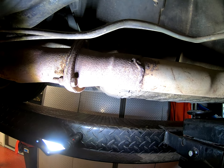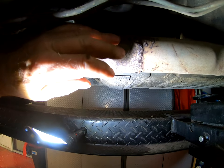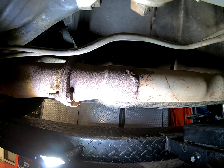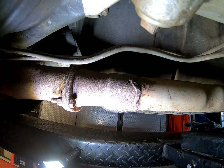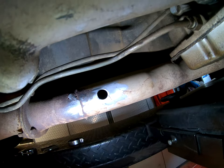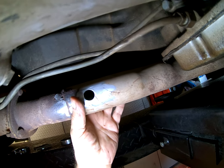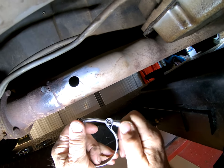So that's the plan — let's mark this up. I've got to make sure I've got room for the clamps, so I may actually have to do a bit of grinding here so I can get the clamp on there nice and flat. I've done it now — I've drilled the hole into the exhaust pipe and cleaned it up. That is a three-quarter hole, which the adapter will fit into. Do be careful if you're using a step drill on a smaller-diameter exhaust because you could punch through the other side, and that would not be good.